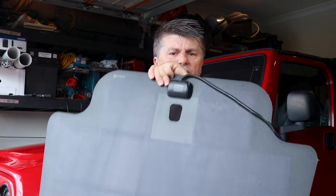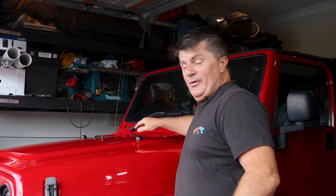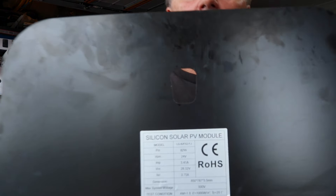So what have I ended up with? I've ended up with an 82 watt solar panel cut to suit the Jeep. You can see the washers go through here. On the bonnet of the Jeep, I've got to remove the rubber bungs here and the footman hoop in the middle — they're basically used if you fold the windscreen down, which rests upon the rubber bungs and ties down to the footman hoop. I've never folded the windscreen down and don't think I ever will. This is about a 3mm semi-rigid panel with a matte finish, so you're not going to get any glare. These are the specs on the back for those who'd like to know.